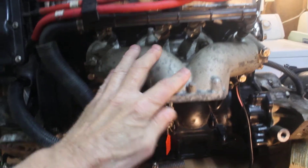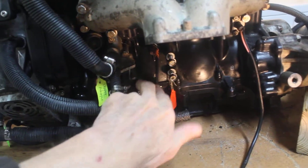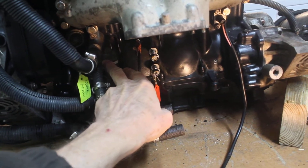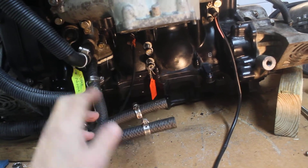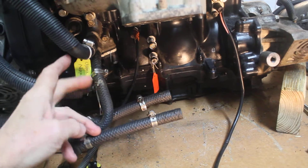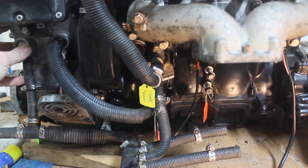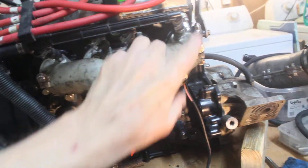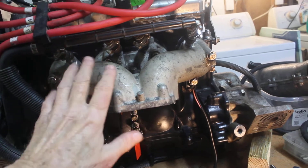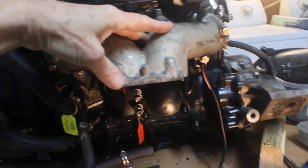The headers also have a water jacket. The water comes in here and goes into this pressure relief device — I think that's what they call it. It has three water lines: one goes to the water jacket around the oil reservoir, and one feeds this header, which in turn feeds the exhaust headers — because the exhaust headers have water jackets in them.